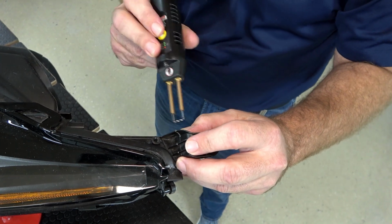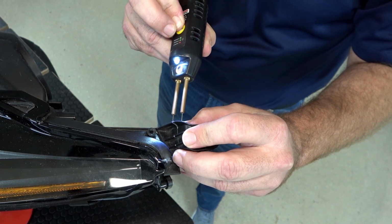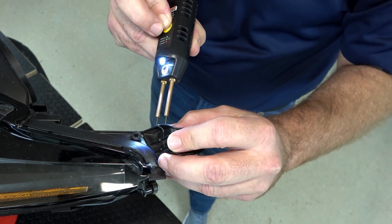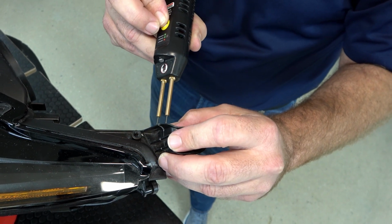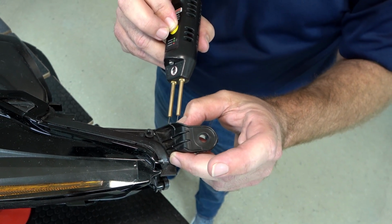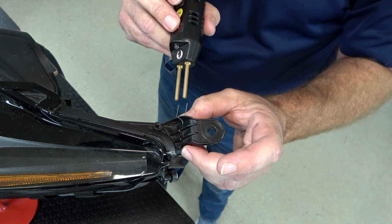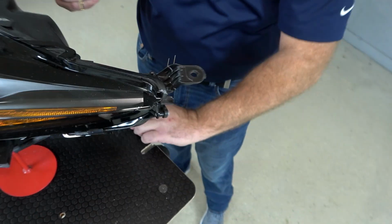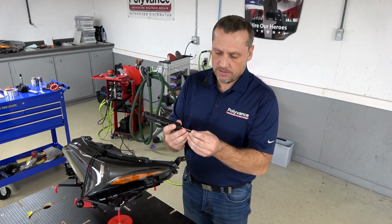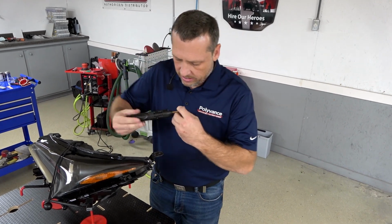All right, so I'm going to go ahead and melt a staple in the side here. And we're putting the staples in the side again because we're going to V-groove deep on the back side and weld and try to do all the welding from the back. So I don't want these staples in the way while I'm V-grooving. I don't want to V-groove deep on the back side and get down to the staples and cut them in half. So we'll put the staples on the outside edge.